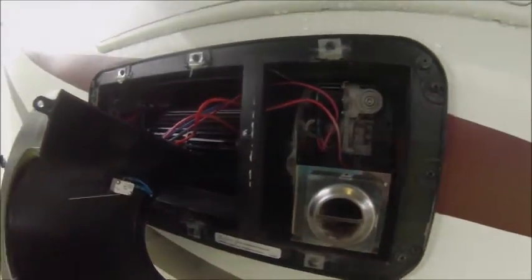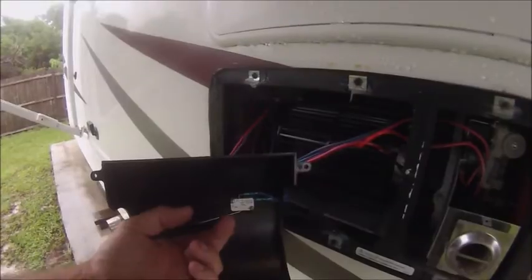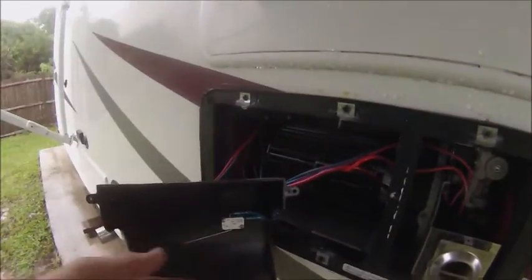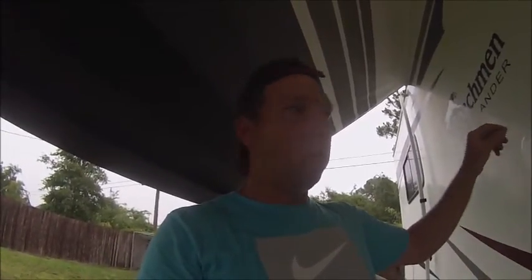This is where that sail switch is, and it could be a major culprit. Mine wasn't actually clicking like this until now — I think it was sticking. I haven't put this back together yet or tested it, but I still think I have an intermittent problem with that thermostat and will be changing it soon. When I went in to test it, the fan ended up kicking on without me jumping it, but nothing else came on. Maybe me messing with or readjusting the wires helped, but I'm not taking any chances.